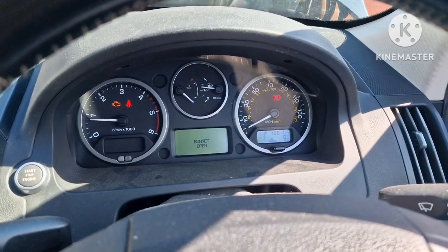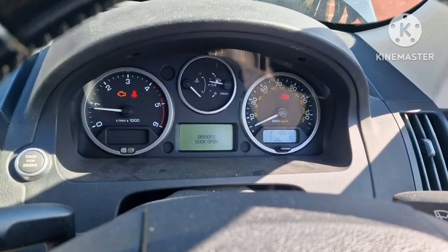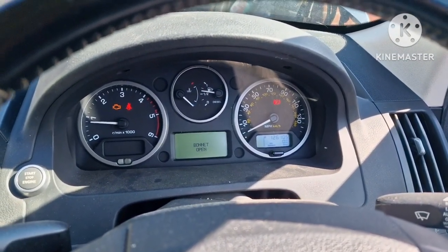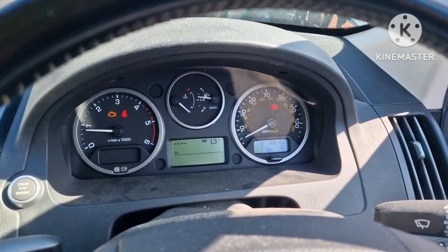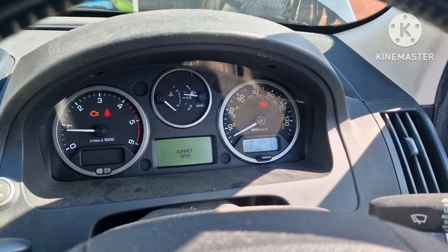And as I say, the starter motor's got a very big load going through it, and you could see it was worn on one side. Once it starts wearing, the plunger's going to come down straight, and it's just going to arc across. The more it arcs, the more it eats away. So yep, that's fixed this perfectly, and reading on the forums it's fixed others.